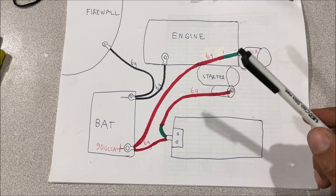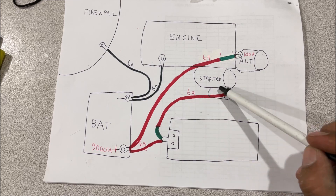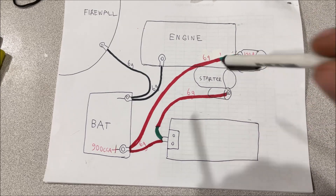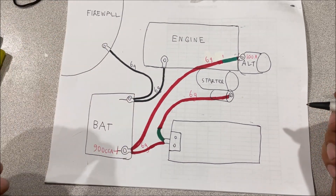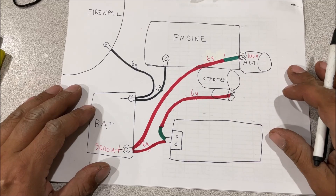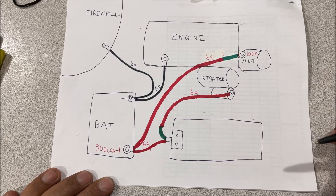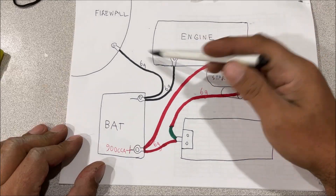I'm making this video because I don't want you to think I'm being rude when I tell you to get off your butt and go pop the hood. I'm being dead serious — I just did it to this Jeep for this video. I didn't even know that fuse link was to the starter; I thought it was to the alternator. By getting off your butt and observing what's under there, you can make a picture diagram of your vehicle. You can figure out what you want to improve or where you do want to fuse, get the gauge of the wire, and know exactly what parts you need. Never fuse negative or ground wires — ever. That's the dumbest thing I've ever heard.